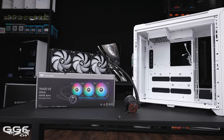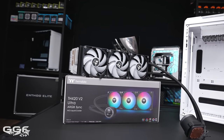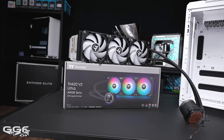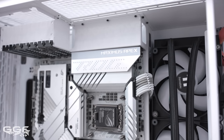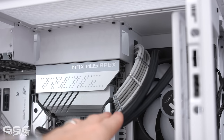Before we take a look at custom water cooling support, the CTE750 is one of few cases with great AIO cooler support, especially if you have an all-in-one cooler on your CPU and an AIO for your GPU. You can have multiple all-in-one cooler options where the radiators are both cooled by outside air. I found up to a 420 all-in-one cooler will fit in the side radiator location, although it was very tight with custom EPS cables. I had to use the cutout above.